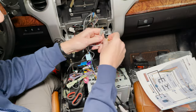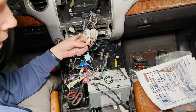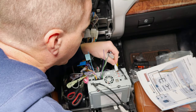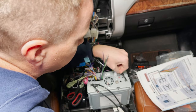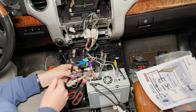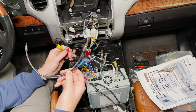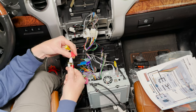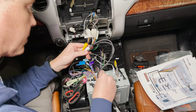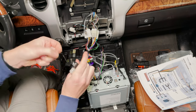This is an amplified system, so I want to make sure we still have rear and front fade. According to the diagram, the RCA input for the left is the white one, so white to white, and then the gray goes in the red — it's marked right on the back of the unit, left and right. Next we've got the audio/video input. I'm not going to be putting any video inputs in, so I purchased an aftermarket RCA to 3.5mm headphone jack adapter — just the silver to white and red to red, skipping the yellow video, and that goes into AV in. We've also got to connect the USB extenders where we can plug in iPhones or Androids.